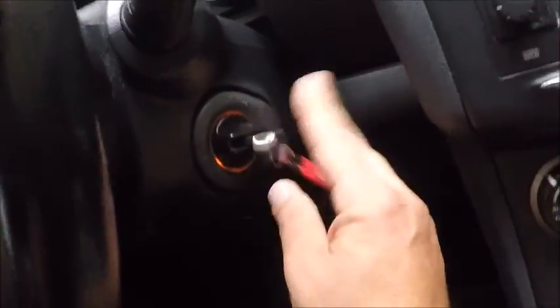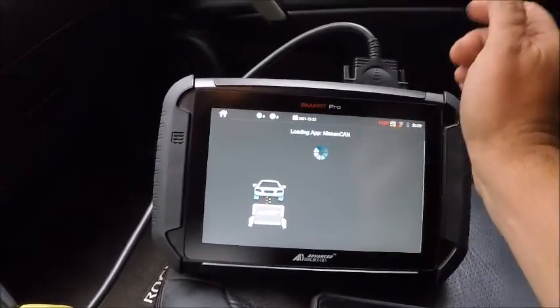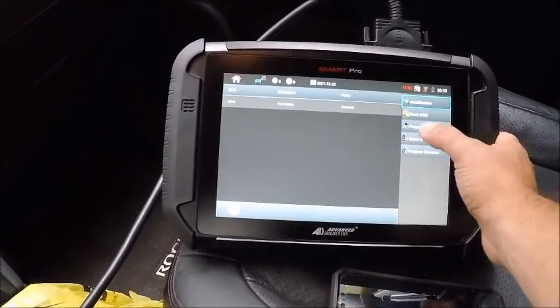This does have a chip in it, so it will not turn — it's not gonna turn until the pin code is accepted. We're gonna leave ignition off, hazards are on, and we're gonna program keys first.